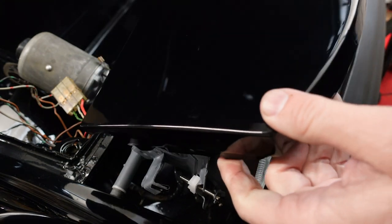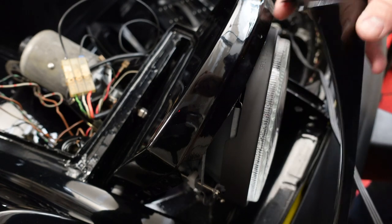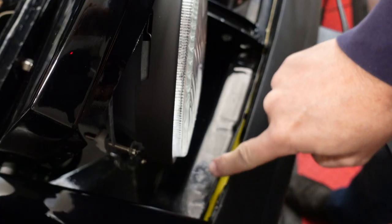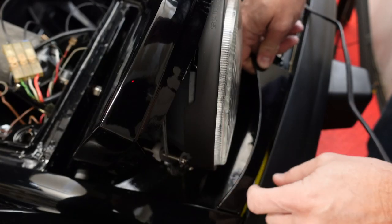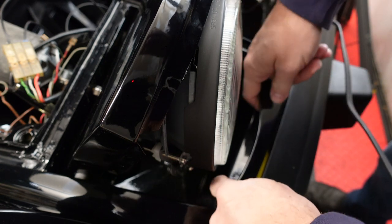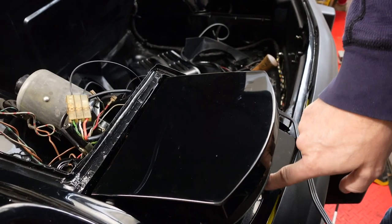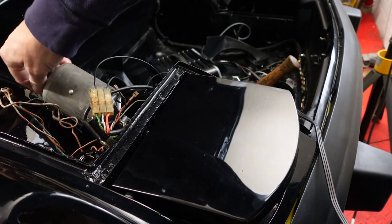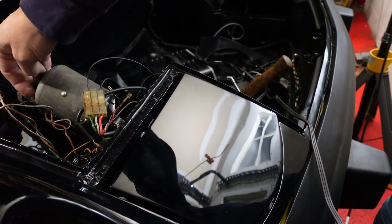Yet another time with the painted cover so that we can get the brows set up. The brows themselves are held in place with these little rubber stoppers — two on one side and one on the other — and also a piece of metal in the front. Sometimes it's bent forward and you've got to straighten it up, but that's also where the brow sits; the front edge has to sit over that metal. As the brow goes into position you can see it's held by the rubber on the sides and by the metal in the front. Now we'll lower the mechanism using the knob at the back of the motor slowly so we can check the gap between the headlight bucket and the brow — you want to go really slow and make sure that we don't hurt the paint. By the way, you can only turn the motor counterclockwise — one direction — otherwise the knob spins off.